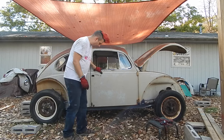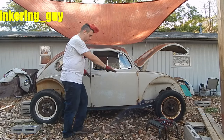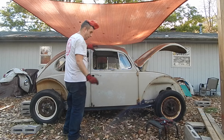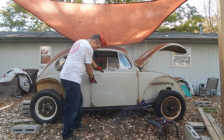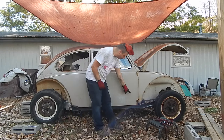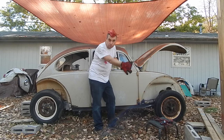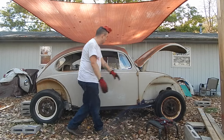On this side, the passenger side, this door was the hardest to close with the strap because of the bowing, because it was bowed up. So that means it was buckling basically, ever so slightly. Obviously, it wasn't enough to keep the roof, but it happened, making this door pinch way too hard down here where this rust is. Now, this already had a kink right here, which means it's had some issues on the door. Somebody reefed it open too hard, or the rust in the reefing, something happened obviously in its past. But here's the amazing part now.